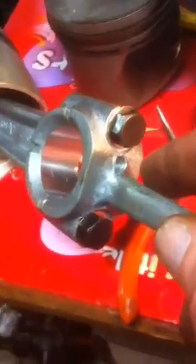The next step is to load up this piston with some oil and push it down into the bore. I have a ring compressor I may use, or if it goes in easy you can sometimes just compress the rings with your fingers. What I'm going to do first is take a sharpie and make a mark across my rod cap so I know which direction it lined up. When I insert this into the bore, I'll make sure the oil hole is oriented toward the crankshaft.